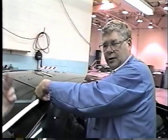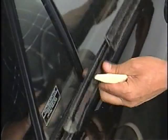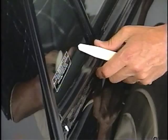That's right. There was one other rear floor leak that, again, was confined to very early production cars. It was here, at the quarter glass on the rear door. There are three clips that hold this outer reveal molding on the door. If these clips were not positioned correctly, the molding would sit up, allowing water to pass through this seam between the outer and inner moldings.